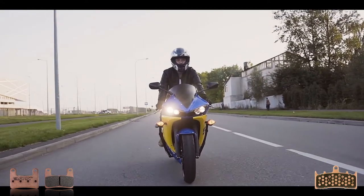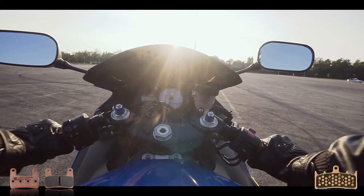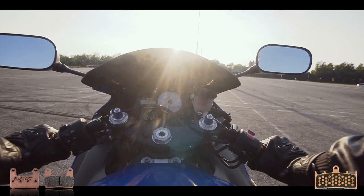These are street brake pads designed for super bikes. The lever feel with sintered tends to be quite abrupt — it's not quite as progressive as an organic pad, but you get a very high friction level. They're fully REG 90 approved, so road legal in Europe.